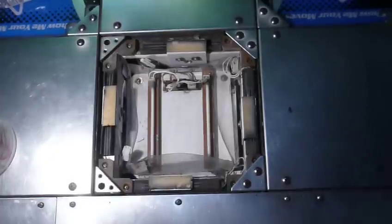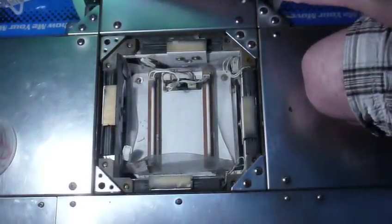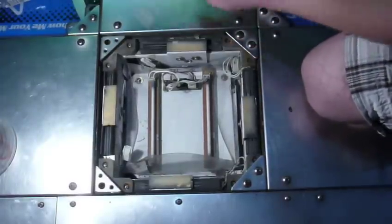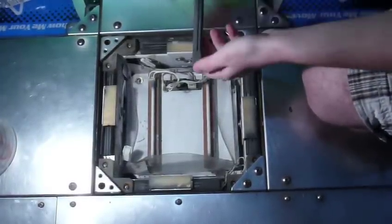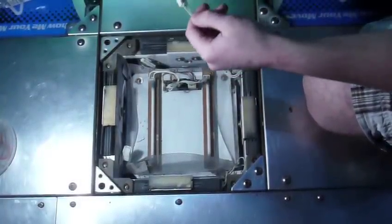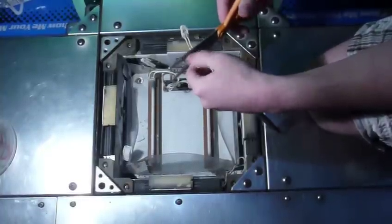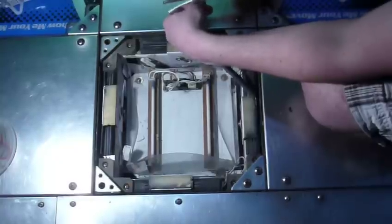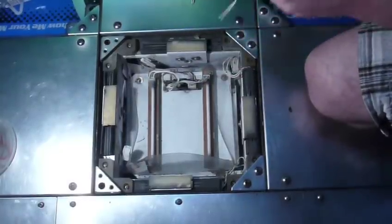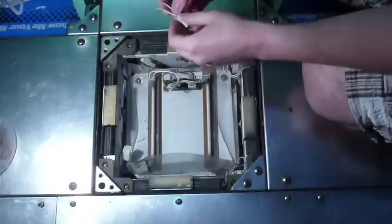Alright, and again, this is going to be a way with absolutely no soldering, and it's been working pretty well in this pad that I've done it with. Okay, so the first thing you're going to do is take your DDR sensor and cut off this connector here. You want to leave a little bit of space so you have some room to work with. Okay, so this is that DDR sensor. You can go ahead and just throw that away. Alright, now we have our connector here.